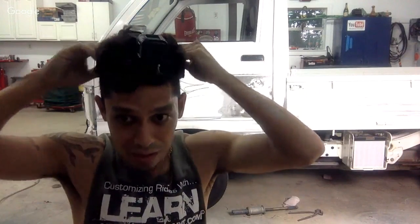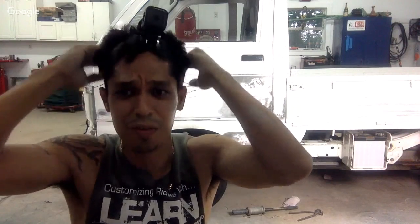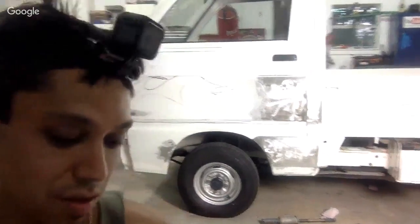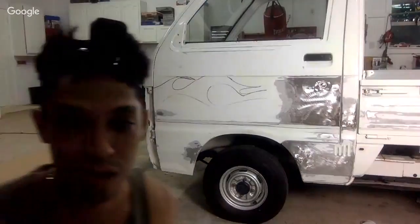Okay. You don't need a flex agent when painting that. Paint is already flexible. Unless you're doing dirt bike flaps or quad panels, you don't need flex agent on regular car parts. I've used it and not used it, same results. I've actually hit stuff with my bumper cover without flex agent, no cracks.